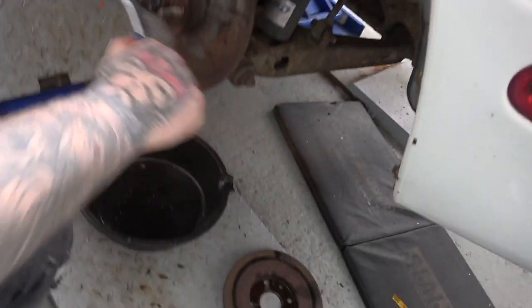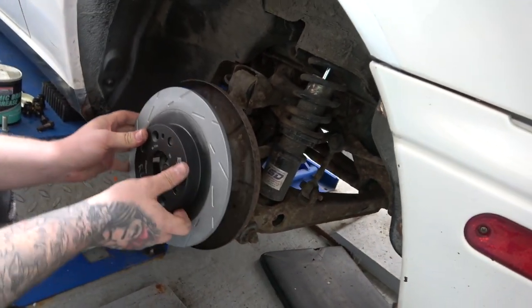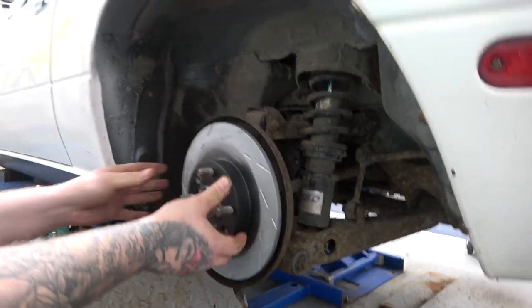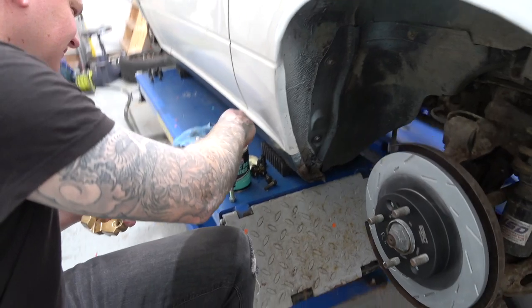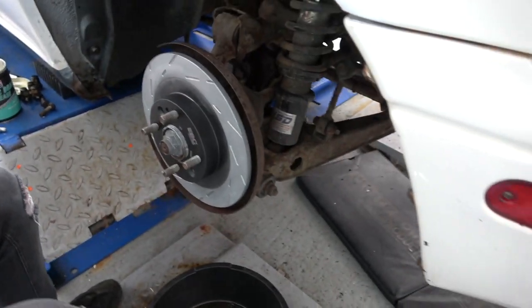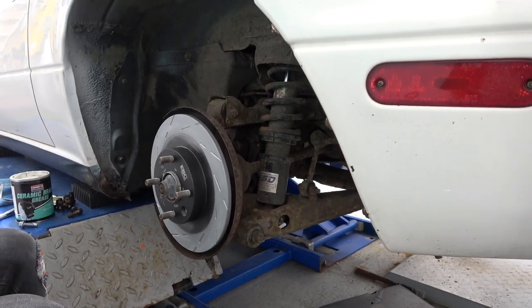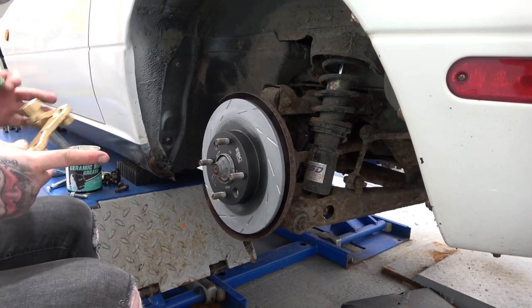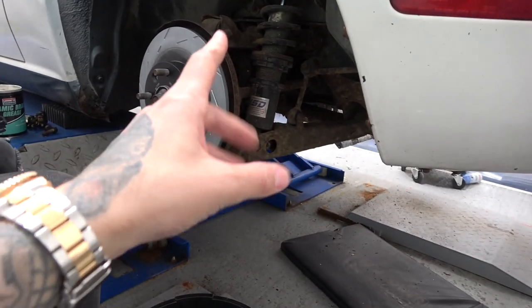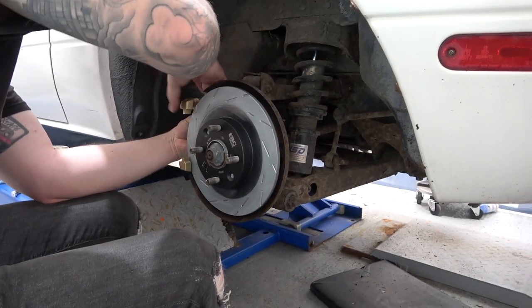Everything's all off - calipers off. Ceramic grease on the hub so that it just makes life a lot easier down the line. I've got brand new dust shields as well but they require the bearing to come off, so we're going to be doing that when we do the overhaul of all the underneath. There's no real gain in changing them right now - it'll just be nicer looking. We're going to be sorting out all this rusty crustiness so that can all be done together at the same time.